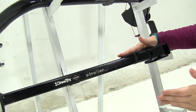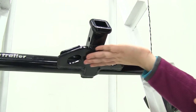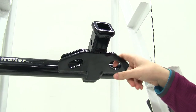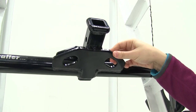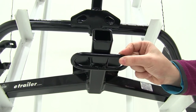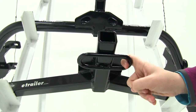You're not going to see as much of the Draw-Tite — most of what you'll see is the receiver tube. Another difference is going to be our safety chain loops. You'll see that our Curt is a plated style with small connection points, but you're going to be able to secure many different style safety chains onto it. If we look at our Draw-Tite, we're going to have a tube shape for our safety chain loops, which will allow us to make connections all around the loops and will also accommodate many different style safety chains.